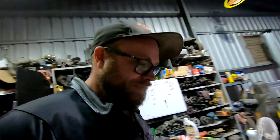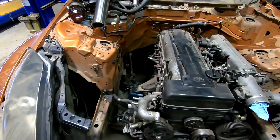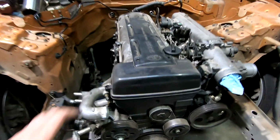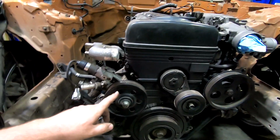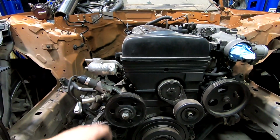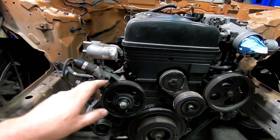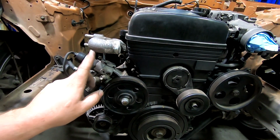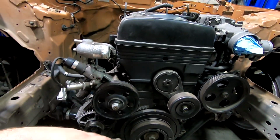And yeah, in the next video I guess we'll have the manifold and that back on. I don't want to put it on yet because it's super hot, but we should have that back on. And then I've got to start whipping off the timing belt cover because I've got to do the water pump. I've got a non-hydraulic one because this has got some kind of other pump in it to do the fans. So I've got to get rid of that, put that one on, put a new timing belt on, do all those bits and pieces.